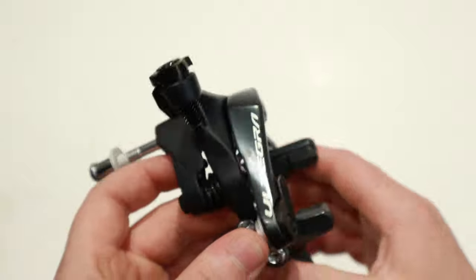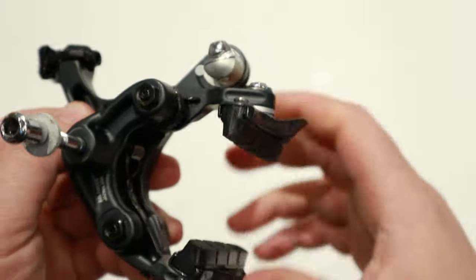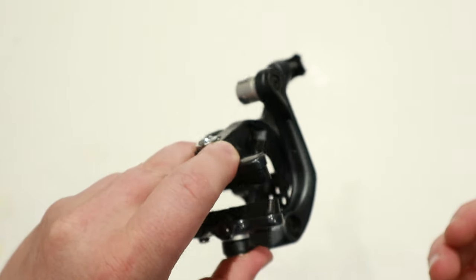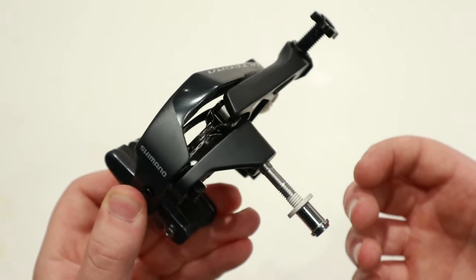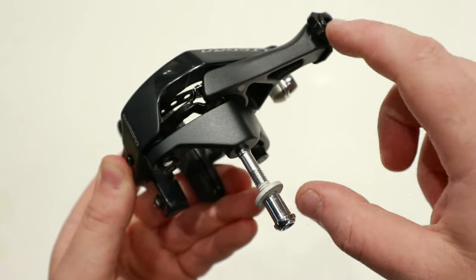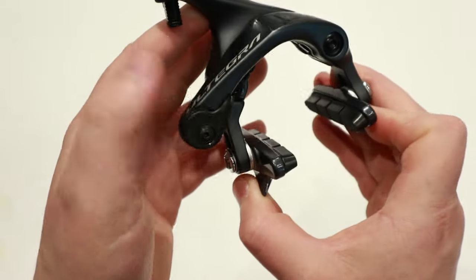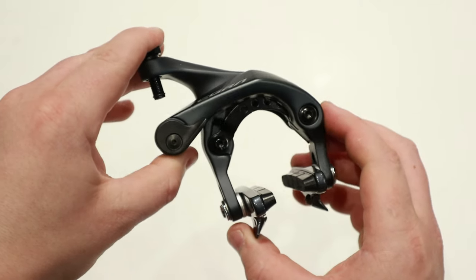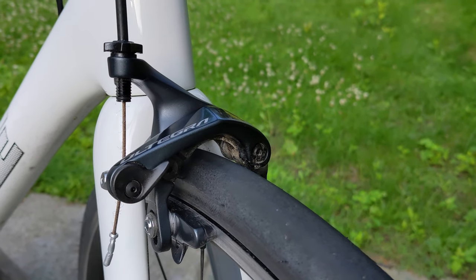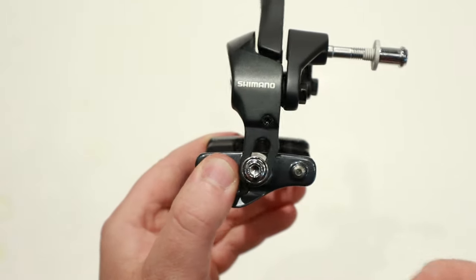Taking a look at this brake, you can see it's a pretty nice looking setup. It's going to be a dual pivot caliper, and one of the neat things is it's going to have quite a bit in the way of mechanics to make it feel super linear in the hand and lighten up the lever feel while still having incredible braking power. If you take a look inside you can see the steel roller rolling on the inside of this cast aluminum caliper setup, and that mechanism is going to allow the side pull to be very even in the way it's pulling the overall caliper. That means you're going to have contact between both brake pads smoothly up against the rim, which should allow for much smoother braking but also quite a bit more power.